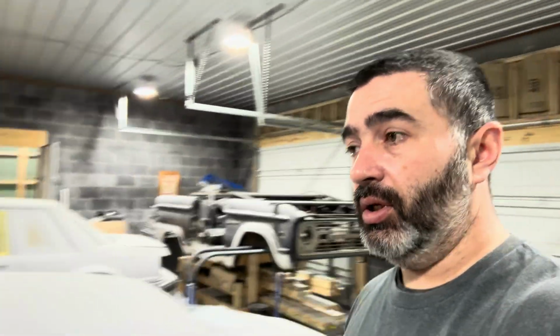If it drops to like 50 degrees outside, that thing runs constant just to keep it 60 degrees in here. It's comfortable in here right now. But if it was like 30 degrees outside, that thing would be struggling to keep it 40 or 45 degrees in here. So I'm gonna have to get rid of that thing and get a bigger unit. That is at 80,000 BTU. I'm gonna try and do overkill and try and get something like 300,000 or something like that.